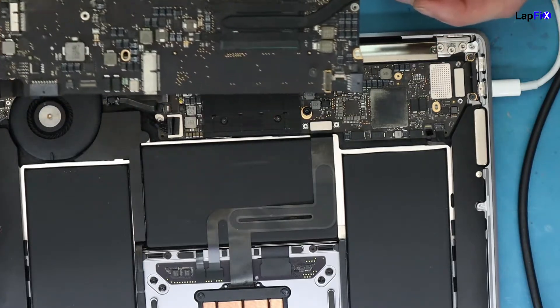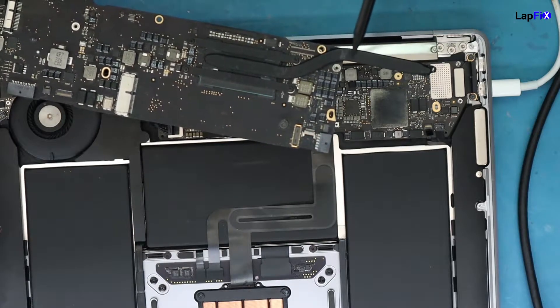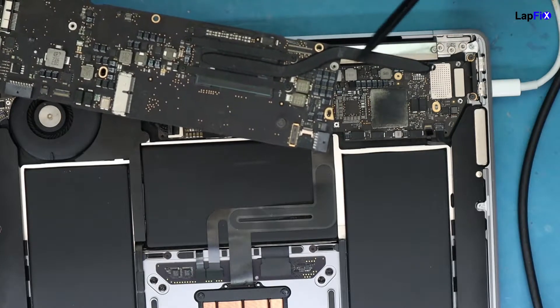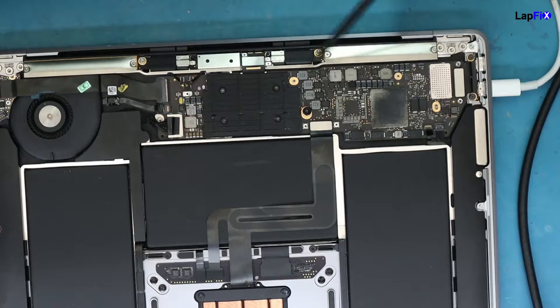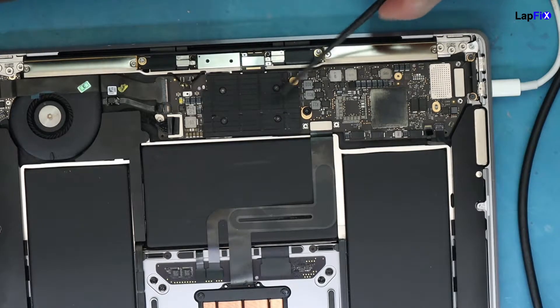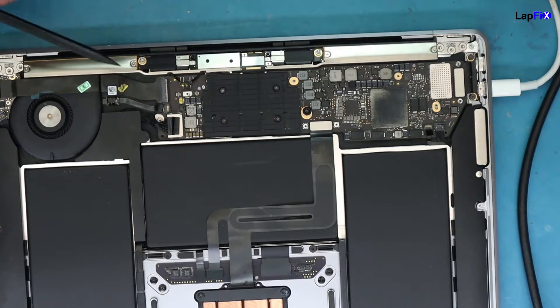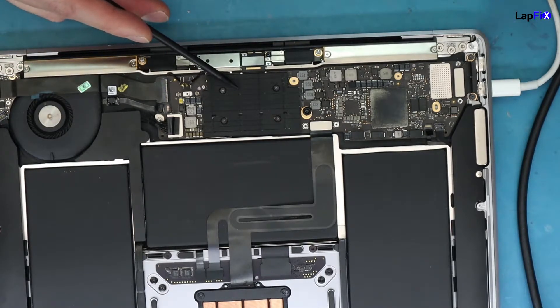We actually do have a great example of what it should look like. There's usually a heat sink here, and there's a fin that actually transfers the heat. The fan would go on one side, blowing where the heat sink is transferring to this metal piece. This design on these MacBook Airs — all the A1932 and A2179 models — have the same type of design. Obviously, there's a reason for this fan to be here; it's blowing air somewhere and has to have a purpose. Maybe there's some engineering we're not aware of, but it's not being used at least to dissipate heat from the processor.